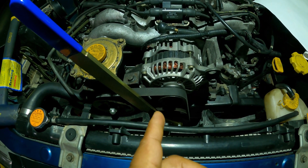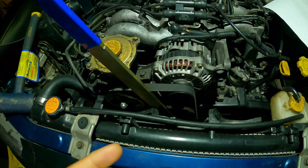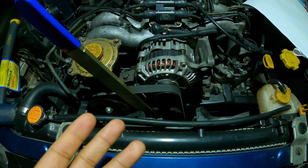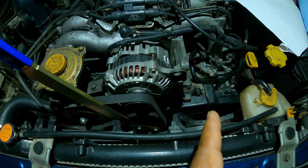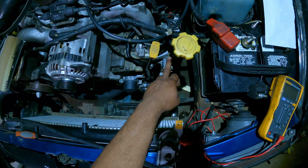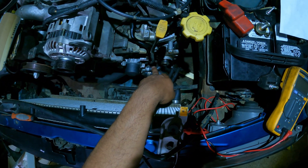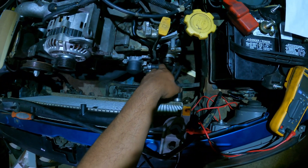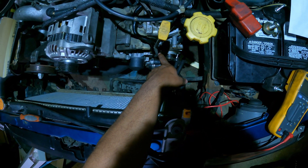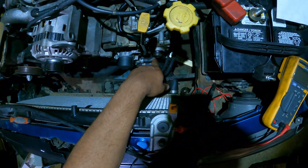The crank sprocket in the middle has to line up before you remove the belt. I'm not here to show you how to replace your timing belt — there are plenty of videos on YouTube for that. So without further ado, let's get into it. I started with the front piece: I took off the cam sensor with a 10mm, removed the 10mm holding the dipstick to the assembly, and now I'm taking this entire assembly off to access the seal on the inside.